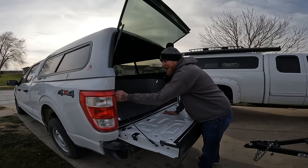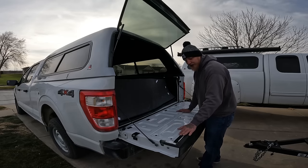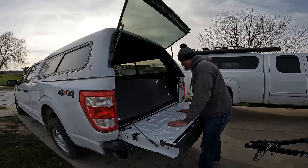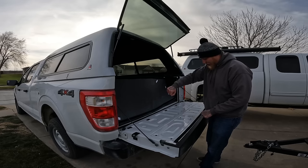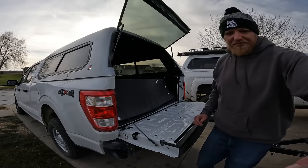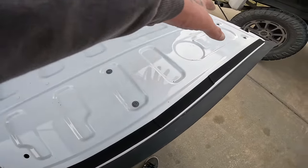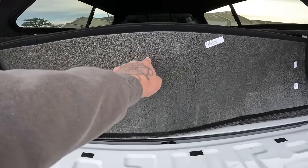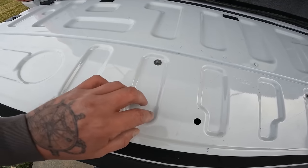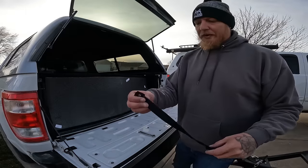The tailgate seal is on there. The instructions say you're supposed to let this sit open for like 24 hours, so I'm going to get this handle done and let this sit open until it gets dark out at least. I need to find a piece of webbing or strap. All these Torx side bolts here are just holding this panel in, so I should be able to back one out, put a bigger washer on there, attach it there, cut a little slit in the carpet and feed it through just like we did with the old one. I can't find a piece of material, so I'm just going to go ahead and rob it off the old truck.